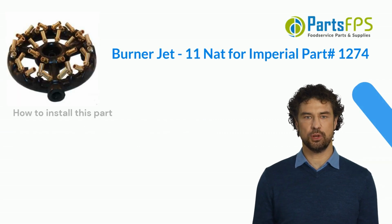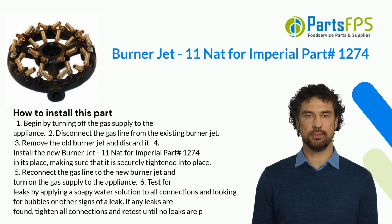Here is how you install this part. 1. Begin by turning off the gas supply to the appliance. 2. Disconnect the gas line from the existing burner jet. 3. Remove the old burner jet and discard it. 4. Install the new burner jet, 11 nat for Imperial part #1274, in its place, making sure that it is securely tightened into place.